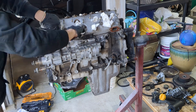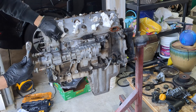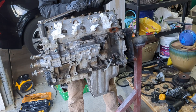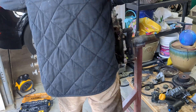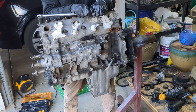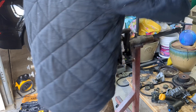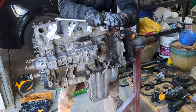I'm now going to work on pulling the cylinder head. The first step is to remove these two bolts — I'm just going to lay them back in place. The bolts for the head are torqued really tight. I had to brace the engine with my body while I broke them loose to keep the engine from tipping over. Similar to the cam assembly, I'm working from the outside in, in reverse order of installation.